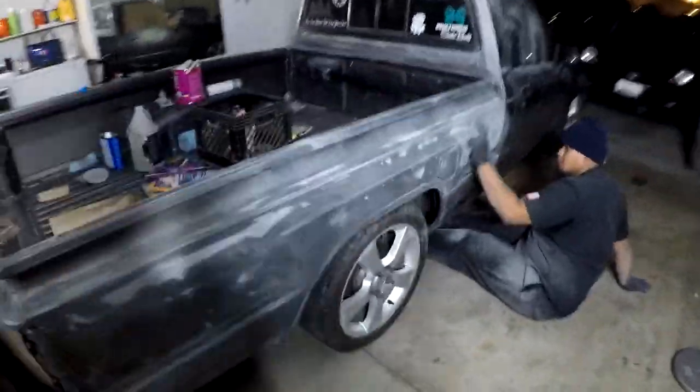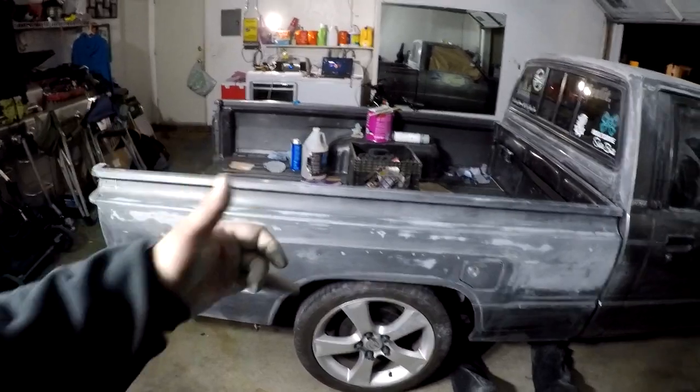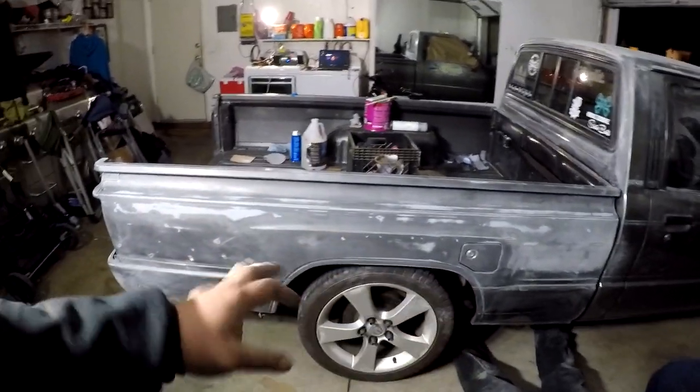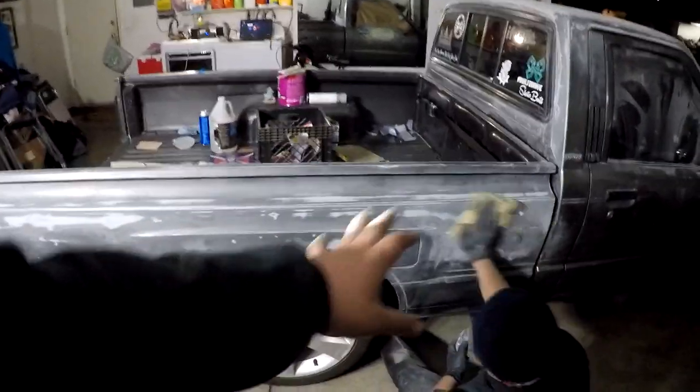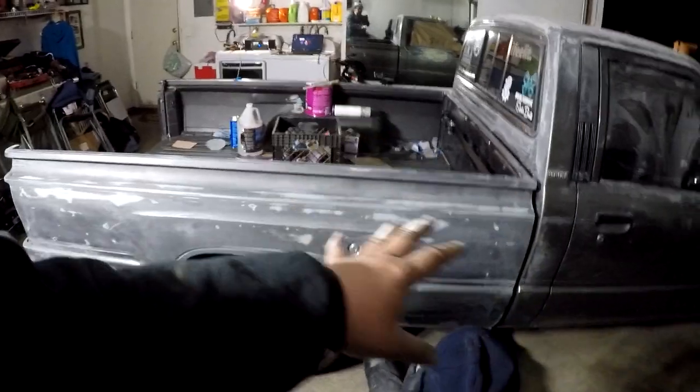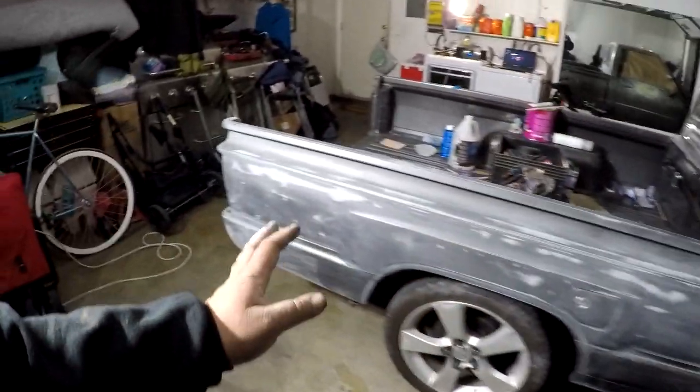While I was gone, my cousin pretty much took care of all of this side, sanding it all down with 220 grit to smooth out the paint. 220 doesn't leave a line scratch, but it does take off the original top layer to get it ready for the base coat.